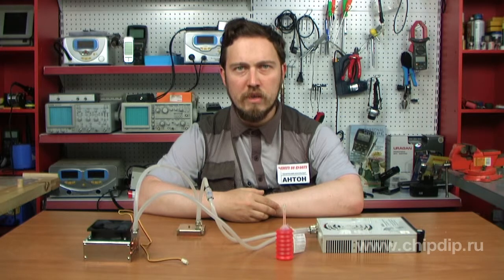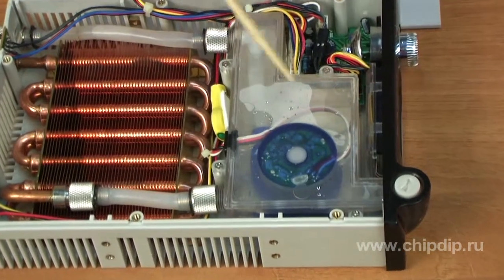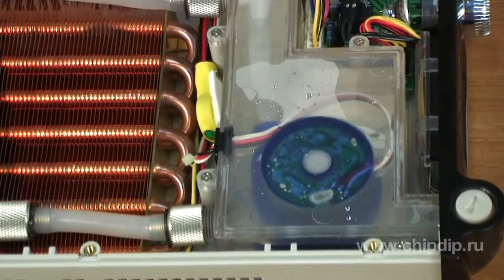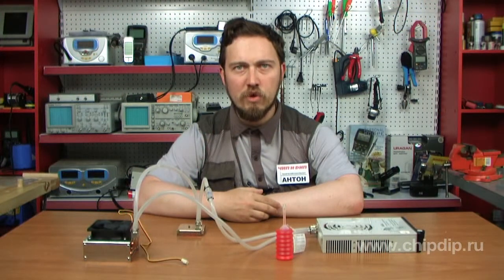Besides computer overclocking, the interest in water cooling is caused by one more aspect. Water is supplied by a water pump, which is practically noiseless. Thus we get rid of one of the main sources of noise in the system unit, the CPU cooler. Moreover, water cooling has another advantage. A regular cooler takes away heat from the CPU but dissipates it inside the system unit. Water cooler, however, takes the heat out of the casing completely, so one could easily get rid of unnecessary fans or at least decrease the speed of their rotation.